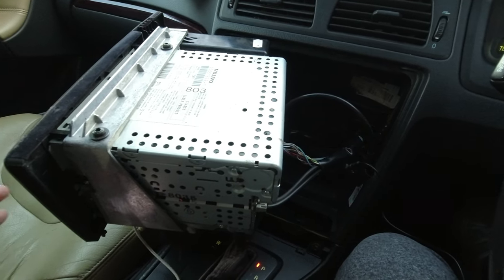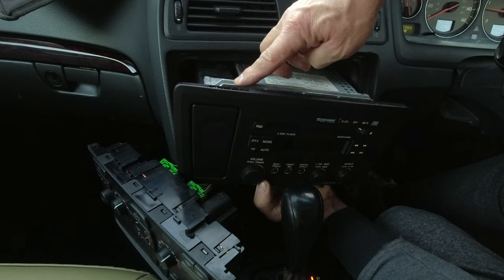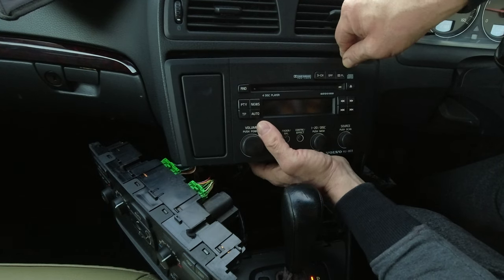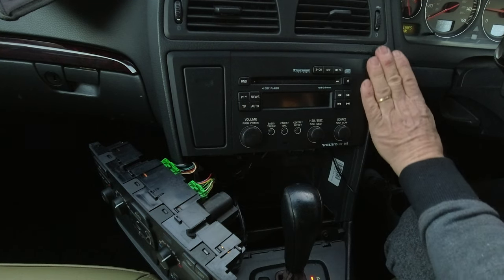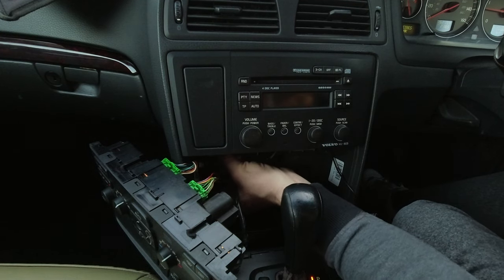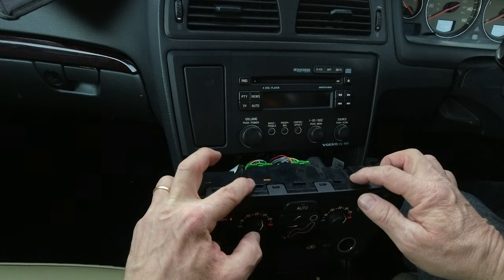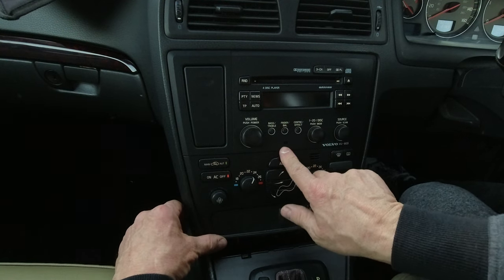Of course, when you put the radio back, don't forget to bring the microphone out or it's useless — common sense. To put back the radio unit and aircon heater unit, it's the same process as before but in reverse. You need to use this guide to insert it under the dashboard — put the radio unit a little down first, then push it up until it kisses the dashboard. After that, put back the two screws and set the two clips, then push gently the unit until it's kissing the dashboard again.